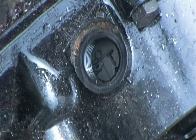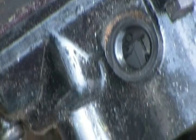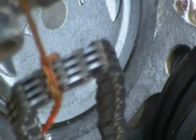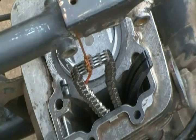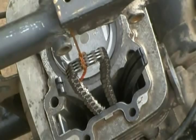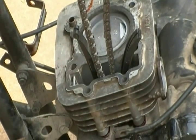See that T inside that hole? That's your top dead center timing mark. Lined up there, and if you look right there, you'll notice the piston is right up at the top of the cylinder. I probably need to dab some of that oil out of there so I don't get it on my gasket surface. I'm going to paint that up with the gasket sealer and then put the head on.